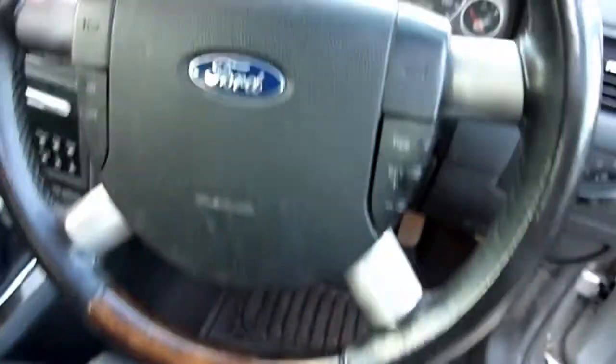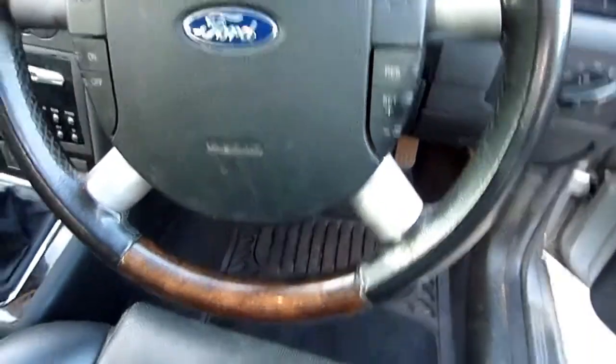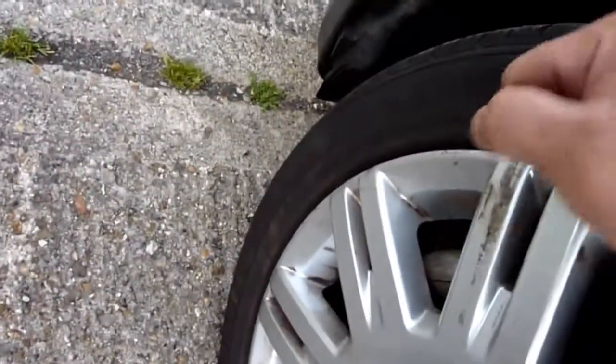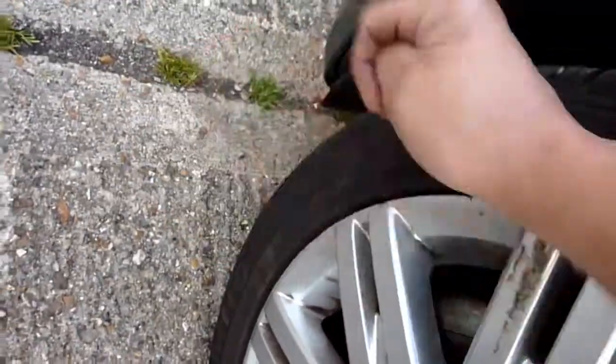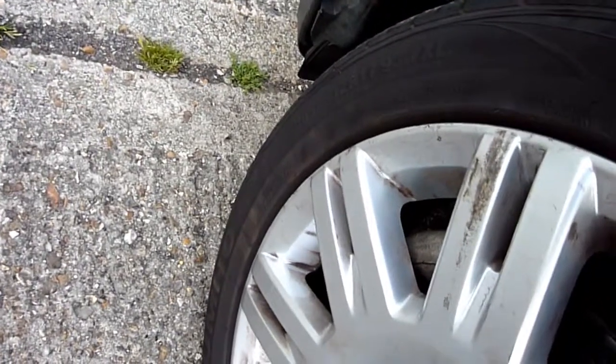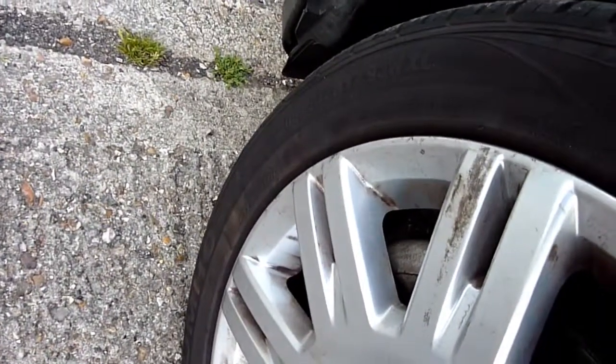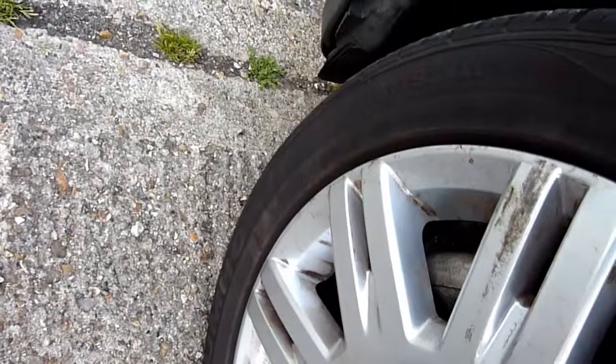Look at the steering wheel — that's how it is when we're going straight. I'm on toe out. I need to bring it toe in. I'll probably have to work this one out. If it's toeing out I need to bring it more toe in. So my thinking is bring this front end on the near side — the left side — inwards, then you'll have less toe out. But in that case the steering will still be off, so I'll have to do a little calculation. I'll put the calculation in the video. I'll probably have to change both sides.